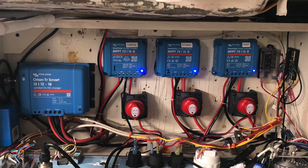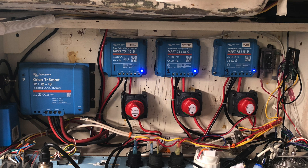One other thing about my solar setup: I have individual shutoff switches for every one of the MPPTs. If I go to work on my battery and turn off my main master switch, I can also shut off all the power coming from the solar panels — because as long as there's sun on those panels, they're creating energy. You need that shutoff switch from the panel to the MPPTs for safety, so your system isn't live while you're working on it.